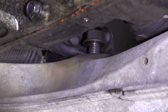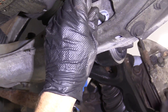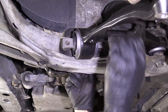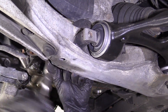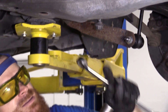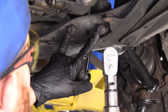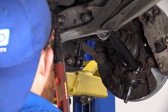Okay, we've got our 21 millimeter headed nut. You could use some thread locker on these bolts if you'd like to — it's your prerogative. I'm going to use my other two bolts through the subframe holes, right into there. You might have to wiggle the control arm around a little bit. I'm just going to snug these up using our 17 millimeter. We'll snug up this bolt right here using our 21 millimeter wrench on top on the nut side and an 18 millimeter on the bolt side.